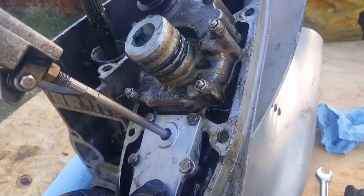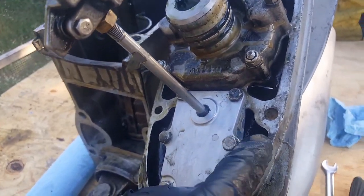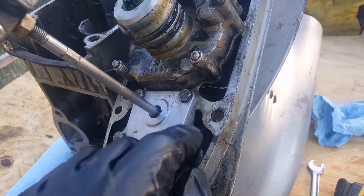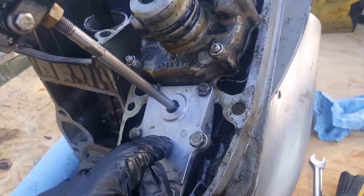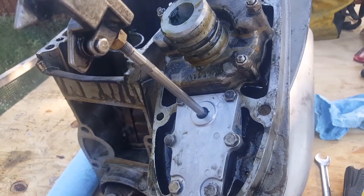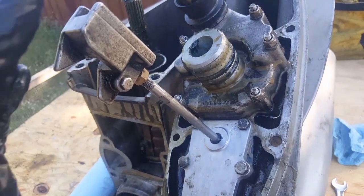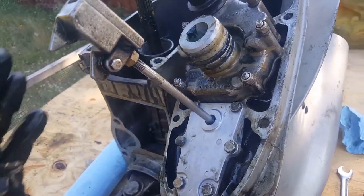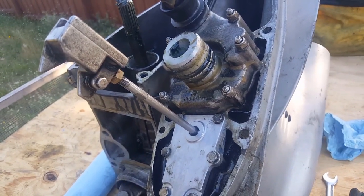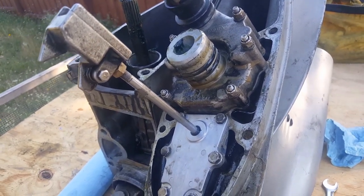It says it right out of the OMC manual: you need to be measuring from the base, and it specifically calls out do not measure from the cover. Remember to measure from up top. Replace these two seals and that upper seal, check your driveshaft, and make sure you put some marine grade grease on that. So that's it in a nutshell for getting your shifter height alignment set. Stay tuned for further parts of this video as we check out the bell crank and make sure there's not a lot of drag on your shift cable. Don't forget to subscribe and like this video.